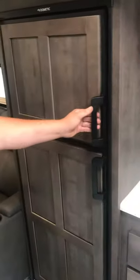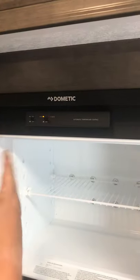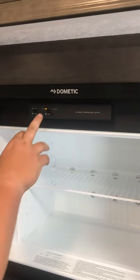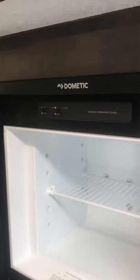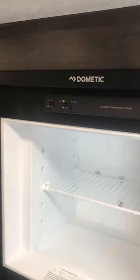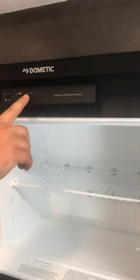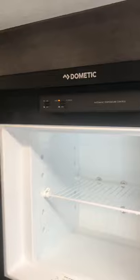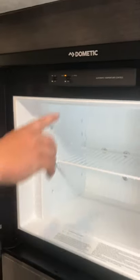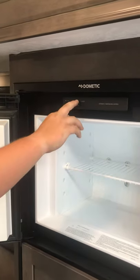The refrigerator has an audible beep — operating instructions are on top inside the freezer. There's basic on/off on the left side. You have Auto and Gas modes: most people leave it on Auto, which always goes to plug power first, then automatically switches to propane if you lose power. If propane is off or empty, a check light will illuminate and you'll hear an audible beep alerting you the fridge won't be cooling. If you want Gas only, depress the button out to switch to propane without auto mode.